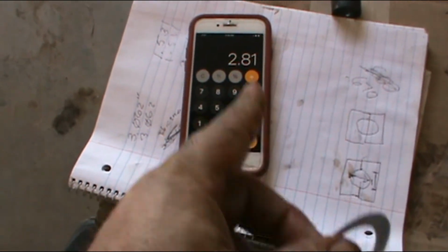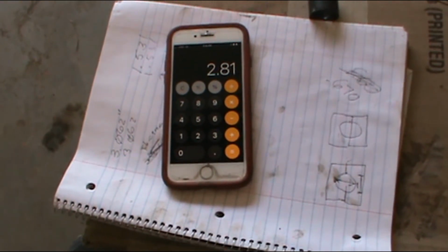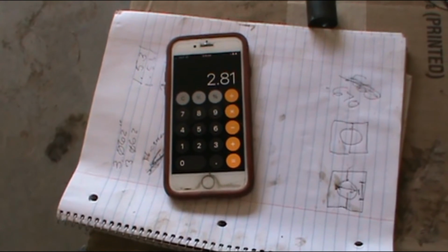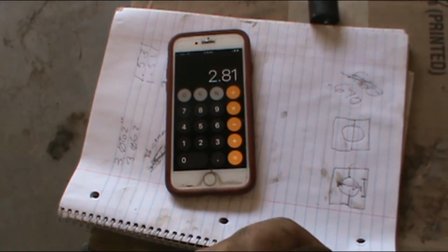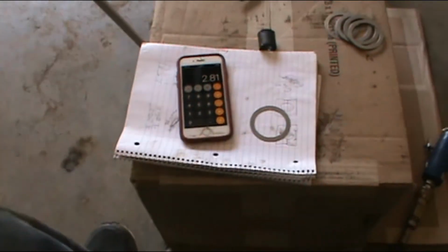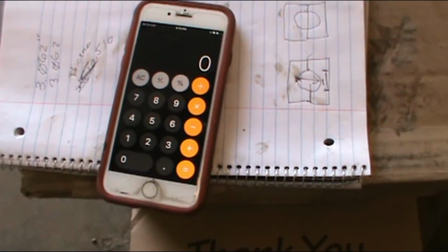I'm going to double check it. I know I recorded it. I'm going to double check on the end of the pinion before I push everything off that I need to come in, that I want 2,825. If I do want 2,825, then I'll just add this 15 and we'll be done. I'll press the new bearing on. Alright, well, you should always double check and try it out anyway.